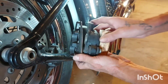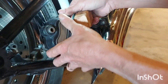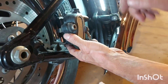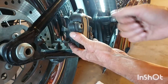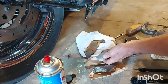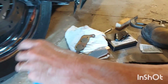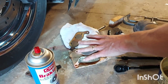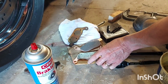There we go. Put our new brake pads in — there's no damage to the caliper face. Go gradually; don't crank the C-clamp down like you're going for broke, just turn it slowly and compress the caliper. Don't touch the face of the brake surface if you can help it. We've got brake cleaner here and we're going to clean it anyway, but try not to get your greasy hands right over the surface — handle them on the edges like this.